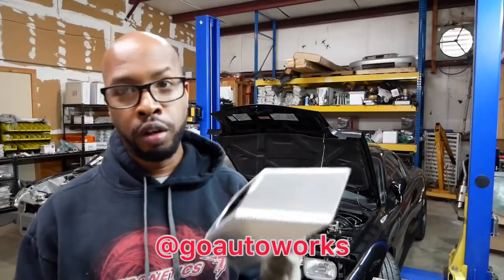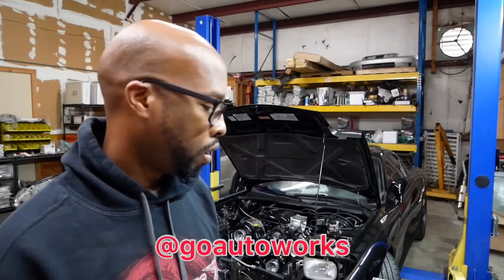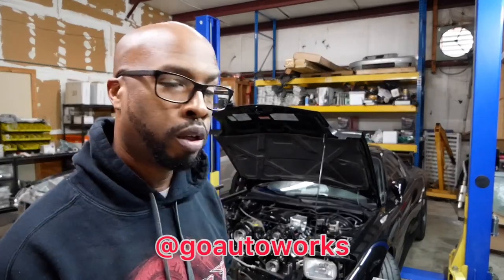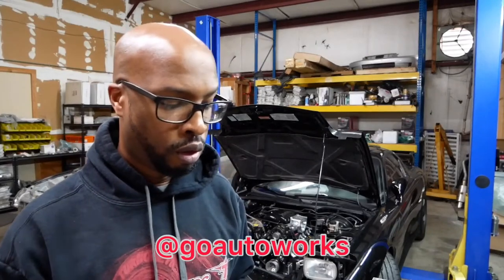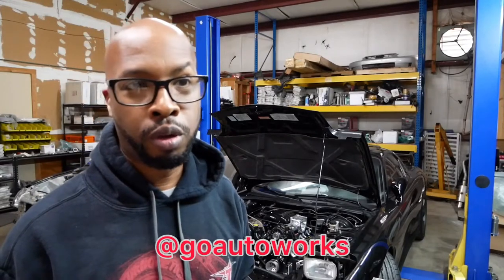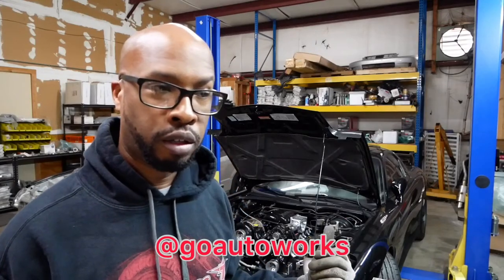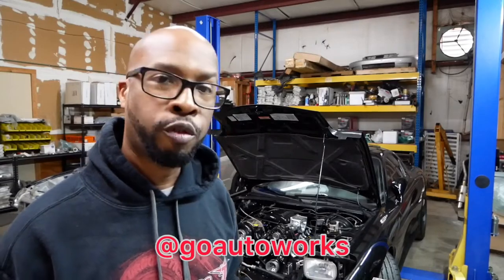I've got the tanks all welded up how I want them, inside and outside. I'm going to go ahead and fit them to the core and get the markings so I can put the mount bung. That way I can mount the whole intercooler assembly without the inlet and outlet on the car, because I will be using a set of Vibrant HD clamps. I'm going to get everything fit up so I can bolt it to the car, as far as the HD clamp fit, because I also have to cut and modify the compressor housing and modify the throttle body inlet for these clamps.